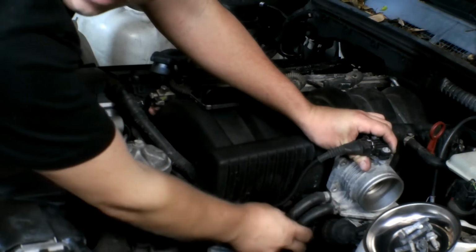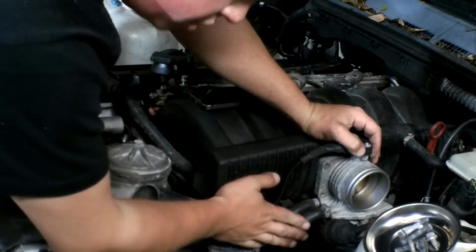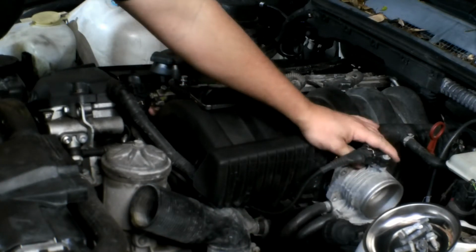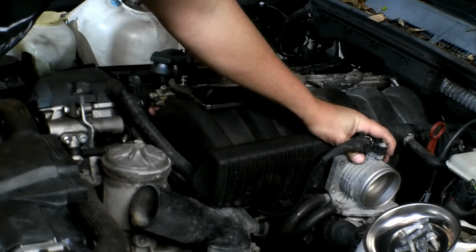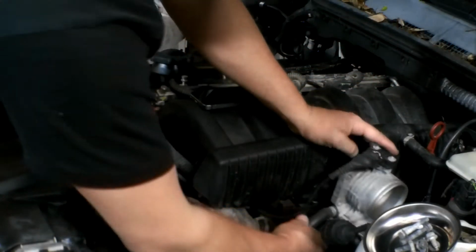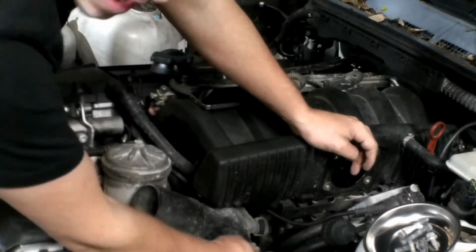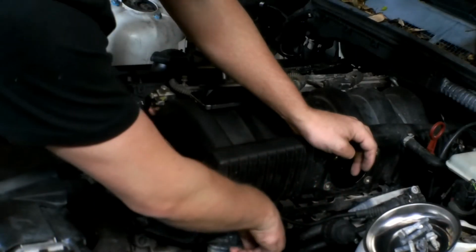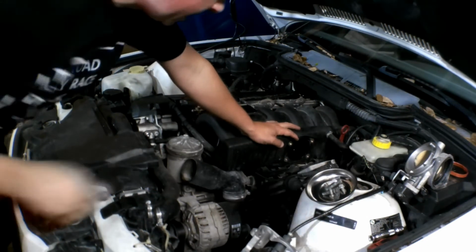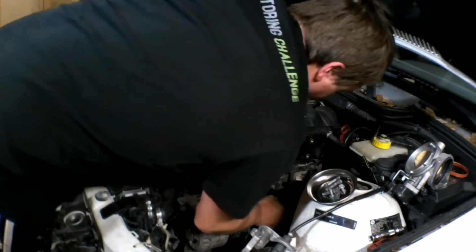If you see here, we have these 2 coolant pipes that go to the throttle body. Well, those are beautiful throttle body warmer lines. So, if we're in deep Siberian winter, you can easily heat your throttle body, which, living in Texas, we do not need that at all. So what we end up doing is, it's a hard pipe right here, and this hose is rubber hose. Take that line off, flip it up, just loop it up and over, connect it, and then you never have to worry about it again. I'll bring you back out. So we'll do that when the time comes. Might do that now just to get that out of the way.